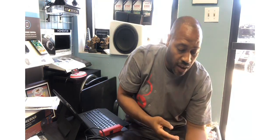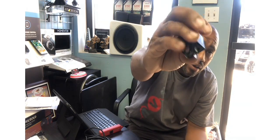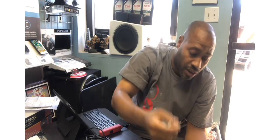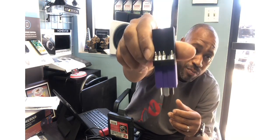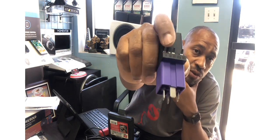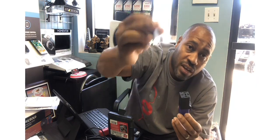This is a really nice toolkit. What's nice about it is if you're testing cars and you have an output that's not working — let's say for a set of fog lights, headlights, or fans, something that's not coming on, even if you're dealing with aftermarket relays and you're not sure why it's not working. So what's nice about this set is you remove the relay from the socket, then you add the relay jumper kit. It gives you all four or five terminals — your two relay coils, your common, and your output. Now you can install the relay back into the top of the socket.